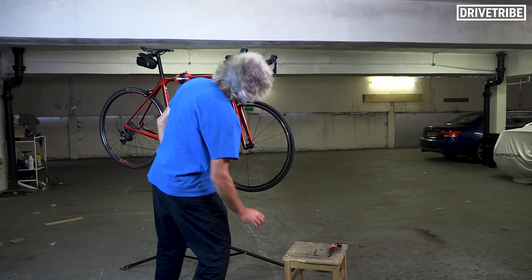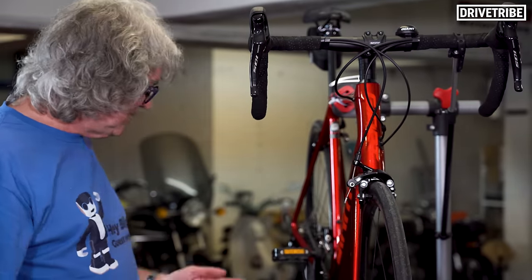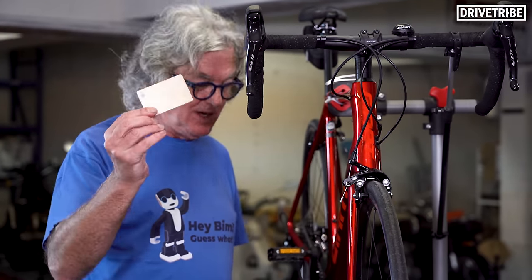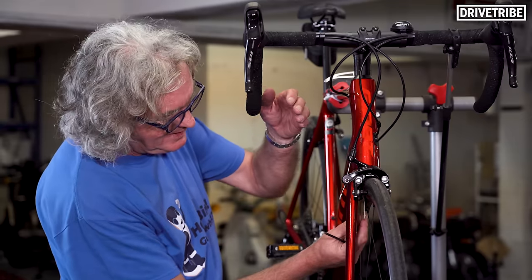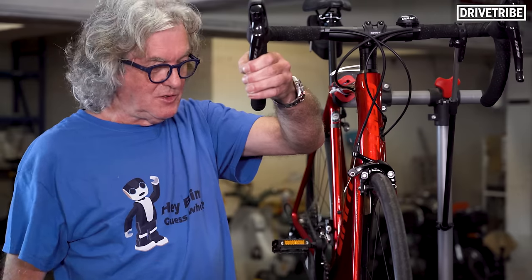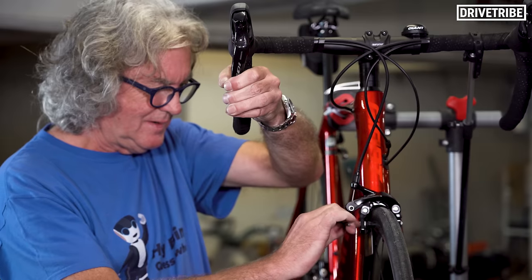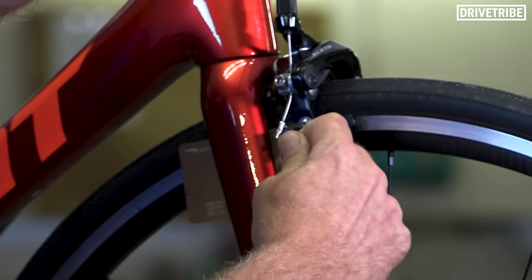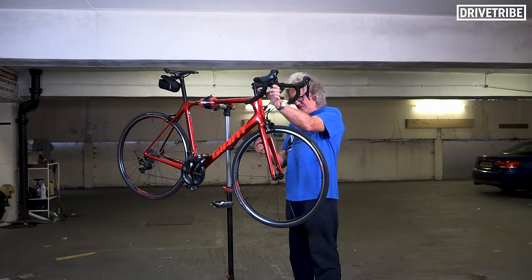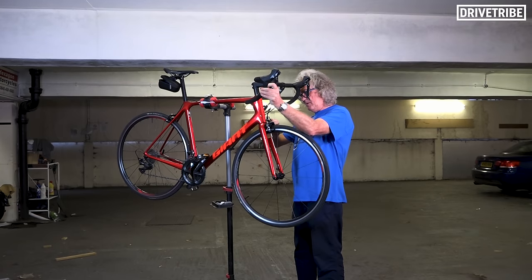These brakes are perfectly centered and aligned. The brake blocks are meeting the rim squarely. Now to make them toe in — that is, this edge needs to contact the rim before the back — you take your British Airways gold membership card, or any credit card, and put it behind the brake block by about three to four millimeters. Put the brake on, squeeze fairly firmly, undo the retaining screw, squeeze, do it back up again, give it a final tighten. Then go and do the same thing on the other side: three to four millimeters on the rim, apply the brake, loosen — you will feel it move — then tighten it up again.